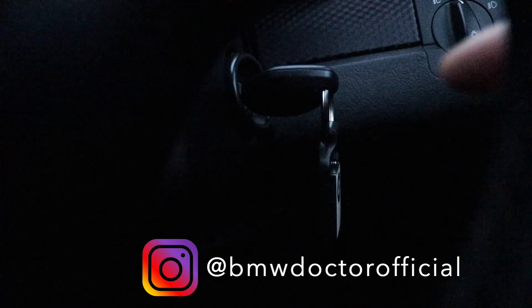On the ignition system here, there's a coil inside which charges the key's internal battery. So make sure you always switch keys if you've got two keys — just be sure to use both keys to charge the battery inside, otherwise it will go dead, so constantly switch between them.